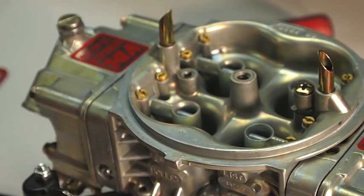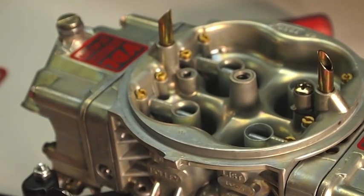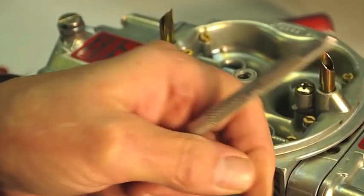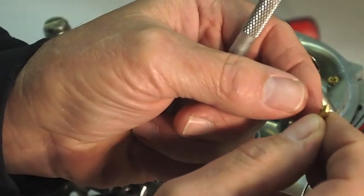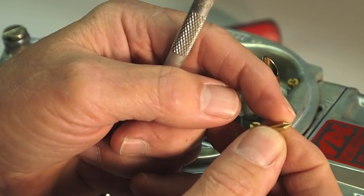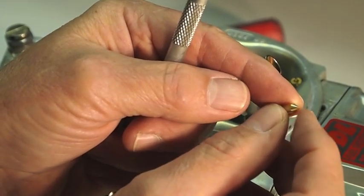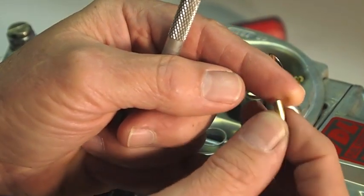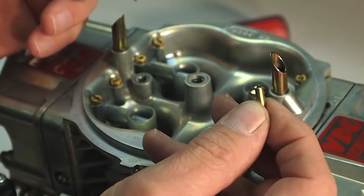The next thing to check is the most common problem with a stopped-up pump nozzle: the check needle that sits down in there. It's a small brass or steel check needle, pointed on one end — the point always goes down — and it goes into a brass seat. This needle will get residue on it, and when the fuel dries out if the carburetor sits for any extended period of time, it gets stuck. It's not a big deal to free it, but it won't let fuel through, and that is a big deal.